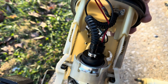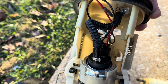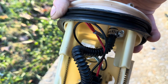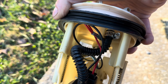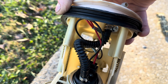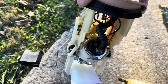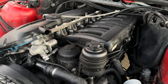I got it all together and everything set perfectly. The crimps that came in the kit were actually shrink type — put a heat gun on them and they shrink down like shrink tubing. A tip for this corrugated hose: heat the end that goes up into the sender unit a little with a heat gun so it goes over the barb. Once it cools it'll grip — it's nearly impossible to slide on without heating. For the pump end I used the assembly lube that came in the kit. It's all together, test fitted perfectly, so I'm going ahead and installing it for good.